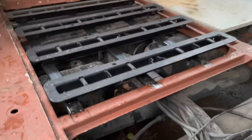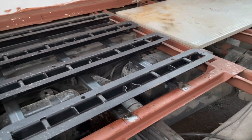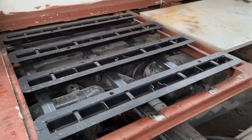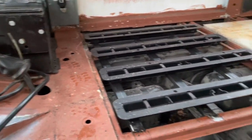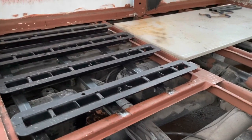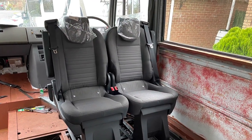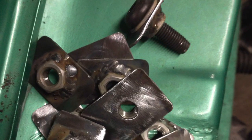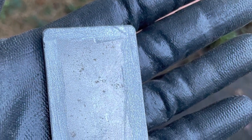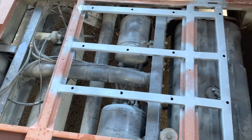Today we've been mocking up - again for however many times - actually on the metal frames this time, so we're ready to weld in the captive nuts and then hopefully after that I can paint it all up and get the wooden floor back down. We tried them forward facing and rear facing to make sure they fit. Luke sent me these pictures of the captive nuts that were going to be welded on underneath. We didn't have enough because I miscounted them, so I had to make some rough ones for him to use on the day. This is ready to be painted up with the captive nuts in.